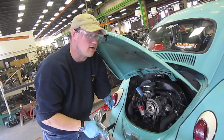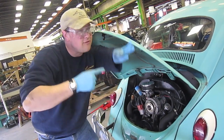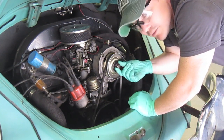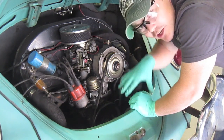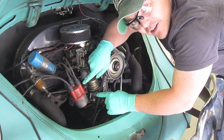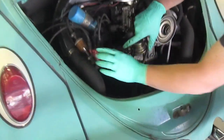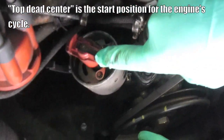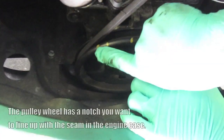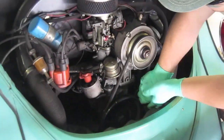At this point, I'm going to turn the engine completely through a full cycle. Remember those push rods I said were kind of tricky to get back into their sockets? Let's make sure they seat properly so everything's where we really want it when we actually get to the valve. When turning the pulleys, the manual says to use a 19mm and a 21mm socket, but I'm going to go ahead and just use my hand. Since the belt's loose, I might have to pinch in and turn the pulley. I need to find my top dead center. I pull off the distributor cap — don't remove any wires, just pull the cap off. This is your rotor and distributor. It needs to come all the way around and line up with this mark. Down here on the pulley, you also need this mark to line up with this portion of the valve.